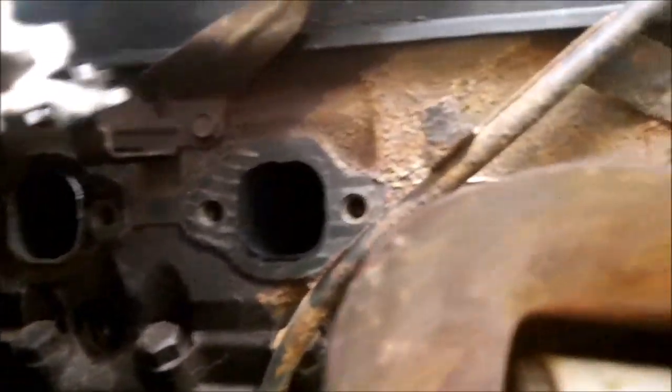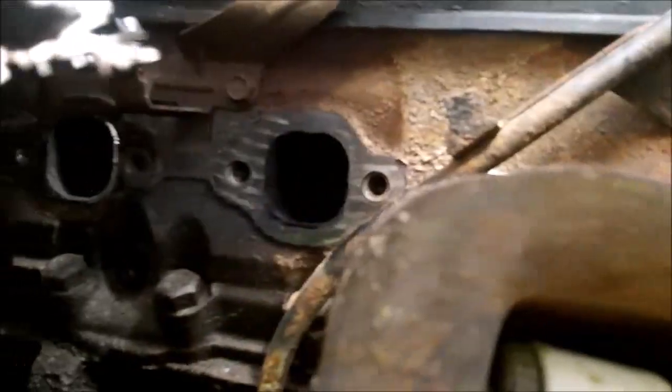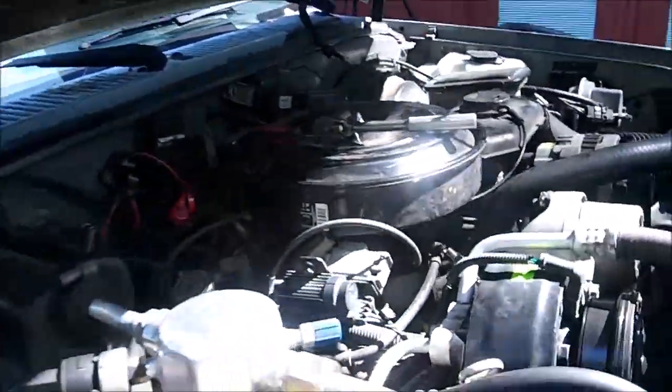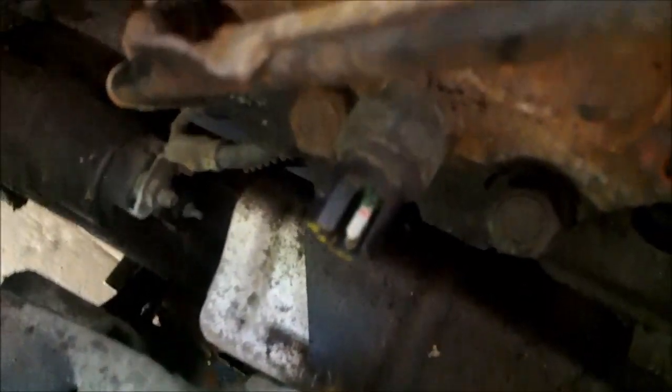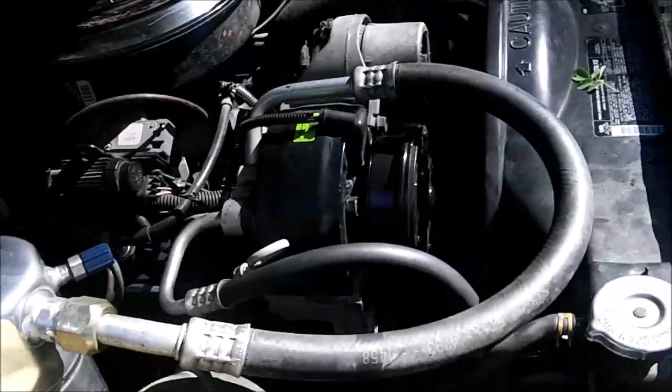As you can see, looking through the fender well, the exhaust manifold is removed, held on by 6 14mm bolts. I also pulled the spark plugs out to keep from breaking them off, because I will be reusing them. I will be putting them back in for now, just to seal the combustion chambers. You also need to unplug a sensor right there, which I believe is a coolant temp sensor. I labeled the spark plug wires. It's going back to the power rail. You've got 2, 4, 6, and then 1, 3, 5 on the left side.